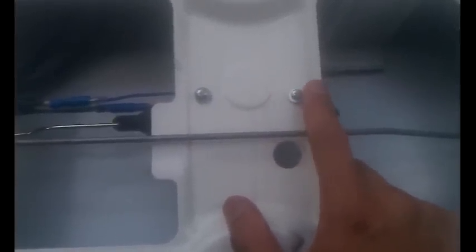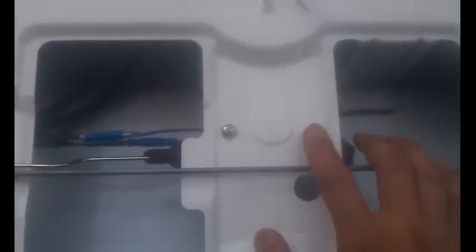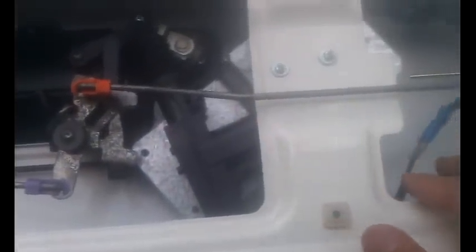Hey guys, I got it back on my truck, wired up. I didn't even put the bracket pieces that went for the camera. I tied it in. I ended up having to Dremel and clean out the plastic because the tube is a lot bigger with the extra wire and the insulated wire I used. The green wire I grounded in here didn't work — not sure why. I went on the forum but no one got back to me, so I said screw it. I ended up running a fourth wire into the cab and grounded it out by the bed.